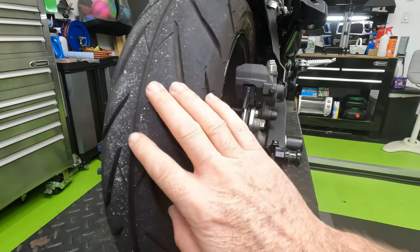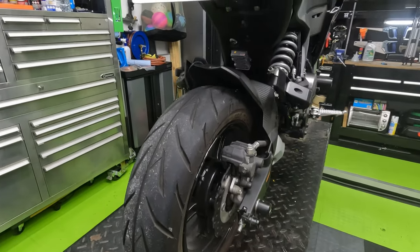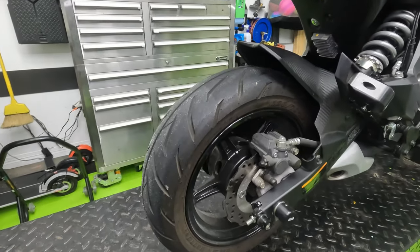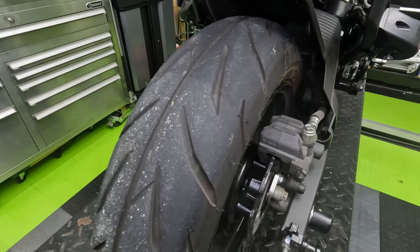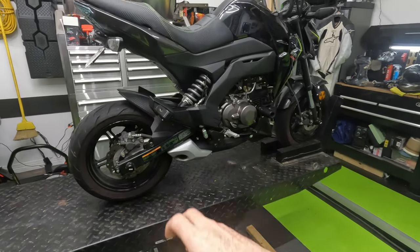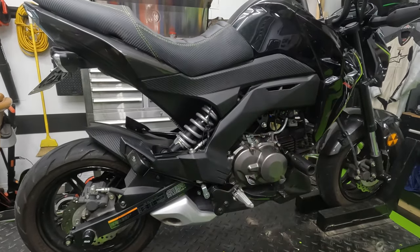While we're back here, let's talk about tires. You might look at a tire and say it's got plenty of tread — that doesn't necessarily mean the tire is ready for the track. Look at things like the date on the tire itself. There'll be a DOT number with four digits on it — that is the date stamp code for when the tire was produced. One good thing to do is take your fingernail and stick it in the tire. If you can't stick your fingernail in and it feels like a rock, replace that tire. On a track, these tires really are your life insurance. They keep you grounded, help you turn, stop, and accelerate. If your tires are old and dry, replace them — you do not want to put your life at risk on old tires.